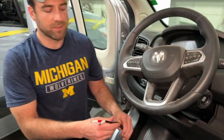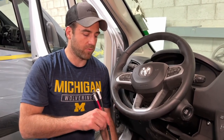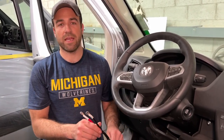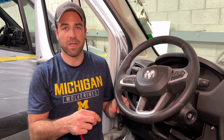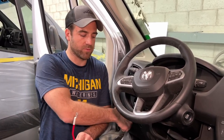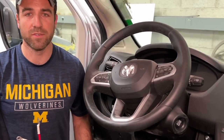In some instances, this EcoFlow provided alternator charge harness will not reach the starter battery. In that case, you're going to have to attach the power to a fuse block and run a 4-gauge wire out from the opposite side and connect to the battery where I had previously showed.